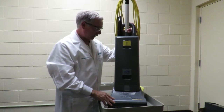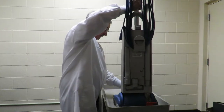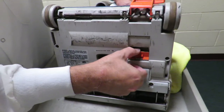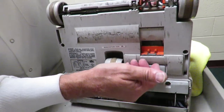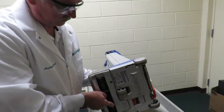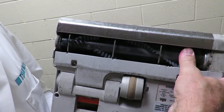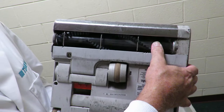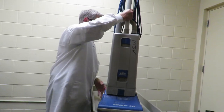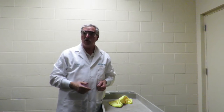So that's the Sensor 12. Now let me show you another vacuum cleaner that wasn't maintained very well — some of the problems we have here. If you notice, the flapper on this one is broken. So what's going to happen is the dirt goes in here and comes right back out — you're just rotating the dirt. And if you can see the brush, it's got hair and debris in there — not too bad, but it could be better. But the brush is sticking out past the guide bar, which is good. A well-maintained vacuum cleaner that's clean with clean filters, a good working brush, flapper in good repair, will work much better for you.